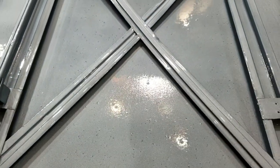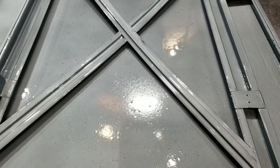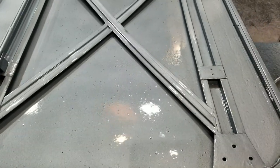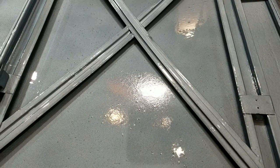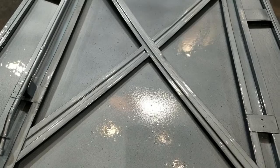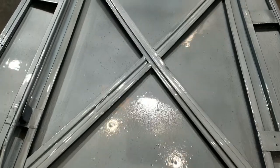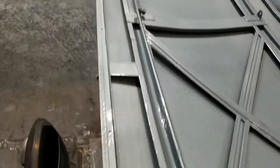Yeah, got a little bit of. See how the reflection kind of changes here. I either had too little coverage or too much air right there. So this is an area where I'd buff out. And this is something that you do buff out, either wet sanding with successively finer grain sandpaper, 1200, 1500, 2000, and then you buff it. So, not bad.